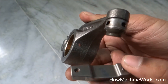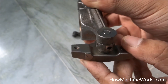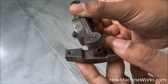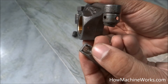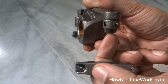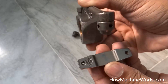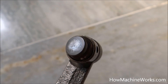The function of the elephant foot is to be placed in between the bridge piece. When the rocker hits — as the push rod is pushed up and down — the effort comes on the bridge piece. Here we have one valve on one side and the second valve on the other side, both seated. The bridge piece pushes both valves together.